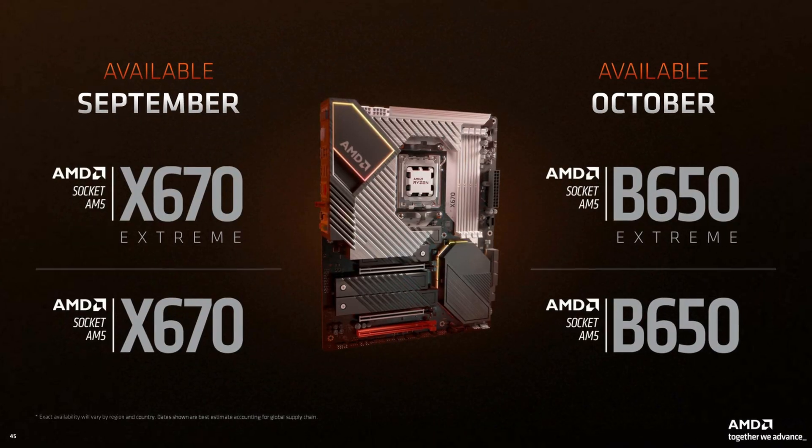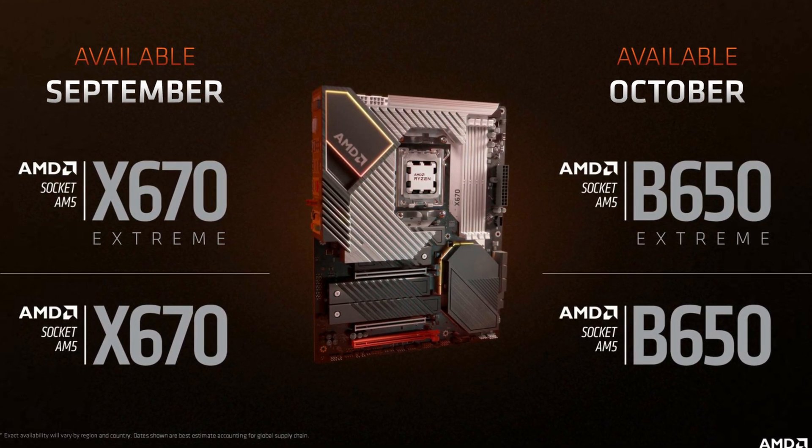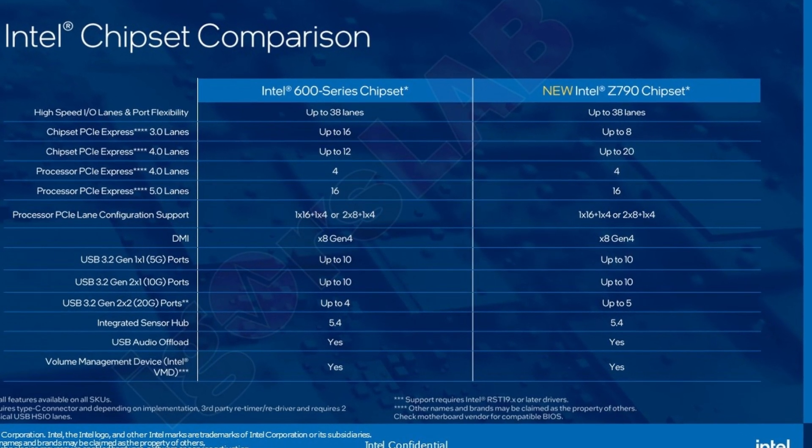I'd love to have a great guide about how much money you have to spend on the motherboard, or what kind of tier of motherboard you should have for what kind of tier CPU, but the issue is that it gets very complicated very fast. AMD's lineup for this generation is pretty messed up with B650 and X670 chipsets as standard, but also extreme variants that kind of overlap a lot. So you end up with PCs like mine where you have a B650 motherboard — technically the step-down chipset — running a Ryzen 7950X. And Intel isn't much better, because while you do have the Z790 and B760 motherboards of this generation, you also have cheaper and better-value last-gen motherboards that are still technically compatible.